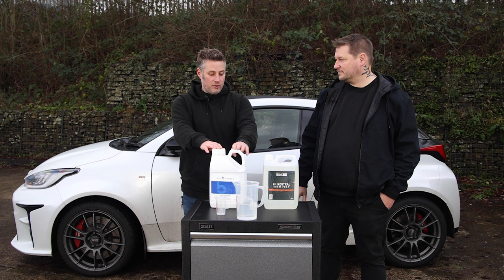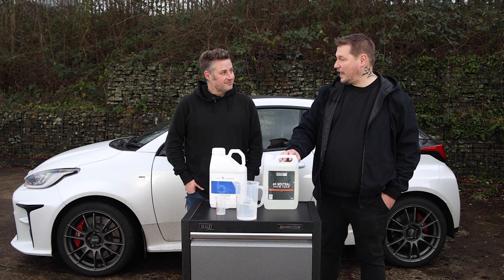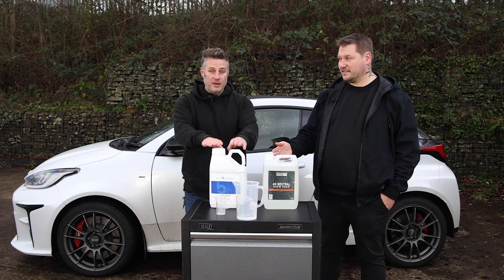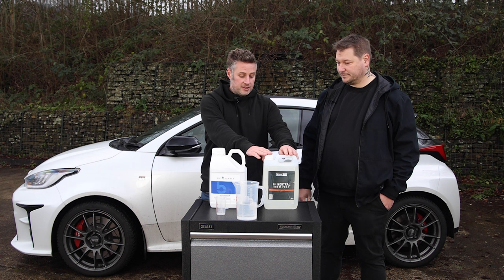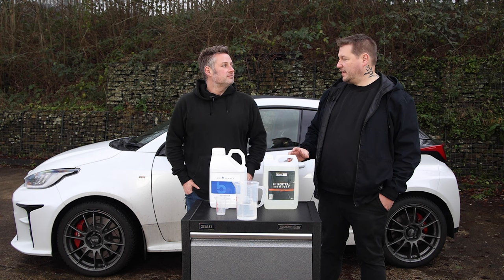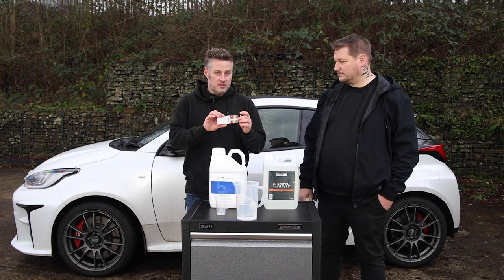We have the question about if you diluted the alkaline down to pH 7, which one would clean better? After speaking with Valet Pro and getting more technical information, there's a lot more science happening behind the scenes. Cleaning based purely on the pH scale - a pH 14 chemical is going to strip dirt and grime, whereas pH 7 is not as caustic, but there's a lot more active ingredients lifting and penetrating dirt that's attracted to the surface of the paint, drawing itself through the dirt and softening it.